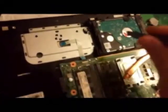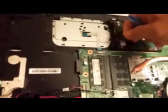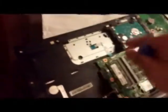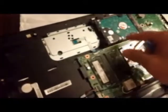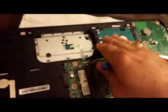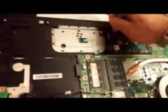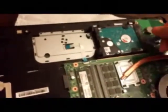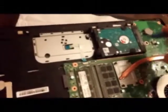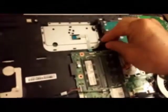The trick is to use a tool like this one. First, on this laptop there's a little rubber bumper that protects the hard drive from moving around — if you drop the laptop it acts as a shock absorber. Pull those rubber pieces out, then use the tool to slide the hard drive back in this direction and you can get the hard drive out.